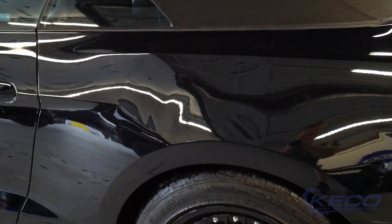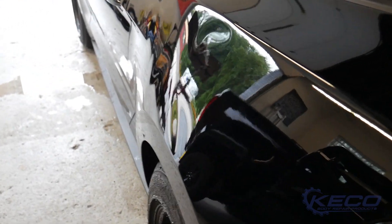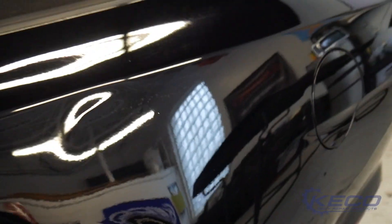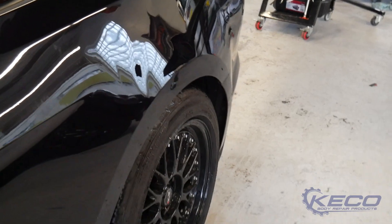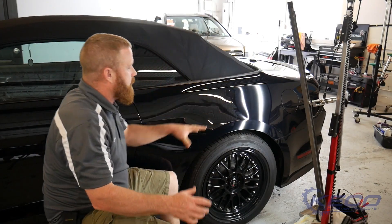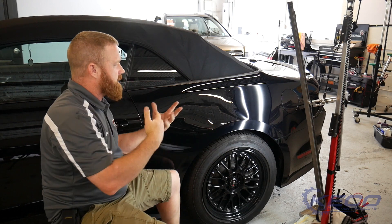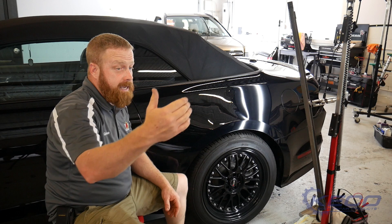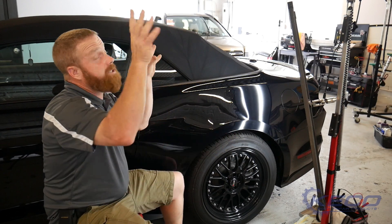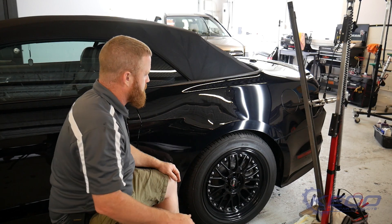So as you're looking at the damage, I'm going to use glue pulling to place tabs in these lows — either pull with a slide hammer, hold tension out with my K bar, maybe set up the K beam — but I'm really looking for some double action movement where I can relieve pressure on the lows while I come in and work all of these crowns down. There's no real good way to film this live, so I'm actually going to set up a camera back a little ways, get you a good reflection hopefully with the ceiling in it, and shoot the entire thing in a time lapse and do a little voice over.